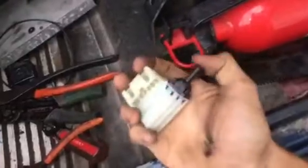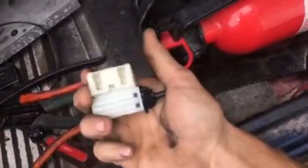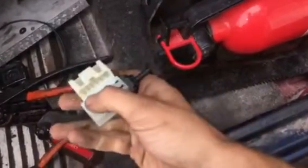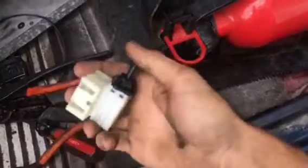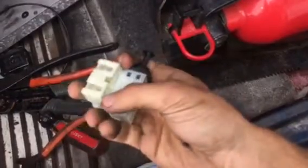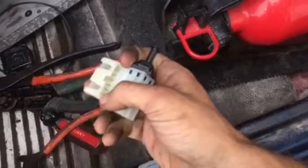So I checked it. The fuse, the original switch is still working, because this is a normally open switch, so when you push the brake pedal down, it engages the output with the 12 volt normally. So I just pushed the brake, this would pop out, and I was having 12 volts on the opposite side on the output. So I knew the switch was working, so it had to be some sort of wiring issue somewhere in between the BCM, the connections, the harness, back to there.